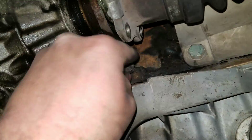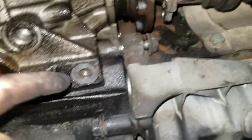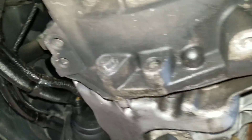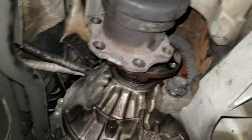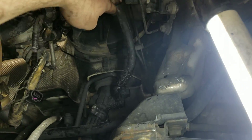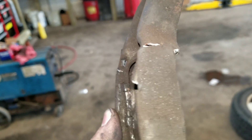It might be smart to break all your bell housing bolts loose before you undo the mounts, because the transmission shakes around like crazy. You have an 18 millimeter on the back/engine side, and on the trans side you'll have three 16 millimeter bolts. Often the axle flange won't clear the flywheel, so you have to rotate the transmission up and then bring it down. When pulling it out, watch out — it can get caught on the power steering line. We had to lower the engine a bit to clear that, and then there was our culprit — it was totally destroyed.